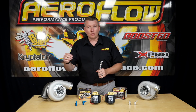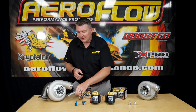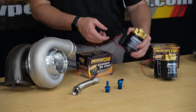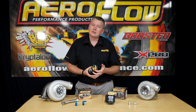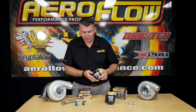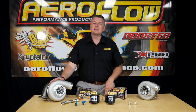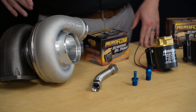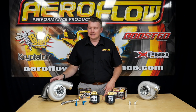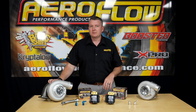So we put the scavenge pump in line with the turbocharger, or feeding off a small intermediate sump where the oil is going to collect underneath, and then it's basically pulled through this pump and returned back to the sump. It's very important to keep the flow, because if the oil sits around and stagnates underneath the core, it's going to fill that core and all of a sudden you'll have smoke out the back and oil out the front — you'll think you've blown up your turbo, but it's just because you haven't drained the oil away from it well enough.